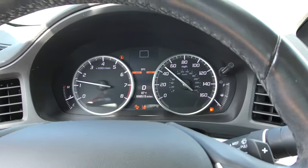Now you just pull over to the side, shut the key off, turn it back on, and the lights are green. Once it's calibrated and completed, all of the buttons on the right side of the steering wheel come to life. I can turn on the main button, which turns on the camera and the radar, and then push the buttons to adjust the distance I want to keep between myself and the car in front. I'm setting the cruise control, but of course when I want to test it I want some cars in front of me — now I'm driving completely on cruise control. There are no cars in front of me, so I can't see if it's going to stop, but ADAS aiming is done.